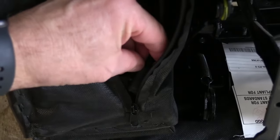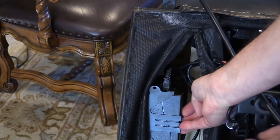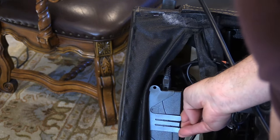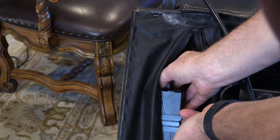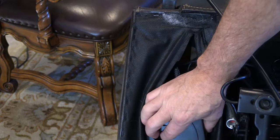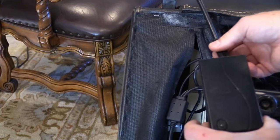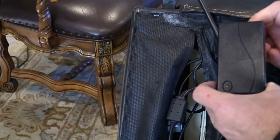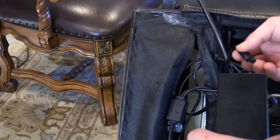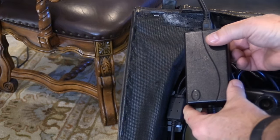You will actually find one wire that goes nowhere. I don't know what this wire is for — it just connects to nothing. Once you've confirmed that all the connections are secure, remove the transformer from its mounting bracket. You'll need to gently lift up on the metal prongs that are holding the transformer in place. Once you remove the transformer, check to see if the cable supplying the power is secure. You'll most likely find that this cable is, in fact, secure, but that there is no power to the transformer. You can tell this because the transformer light is off.